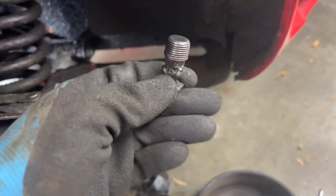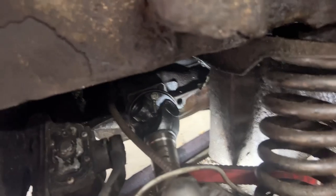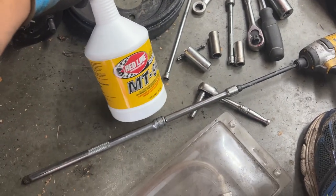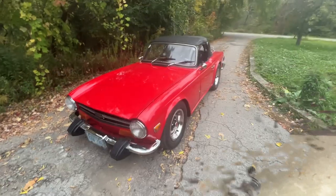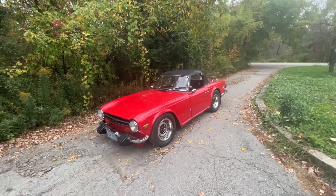That's the plug - they actually welded a bolt to the plug, so that's not too bad. All the axles are installed. Before I install the other half I'm going to top it up with oil - MT90 by Red Line, which is my preferred oil for differentials and non-overdrive transmissions. I just went for a test drive to make sure everything is okay with the shafts - no clunks, nothing wrong. Everything went well, so that's going to be it for today.